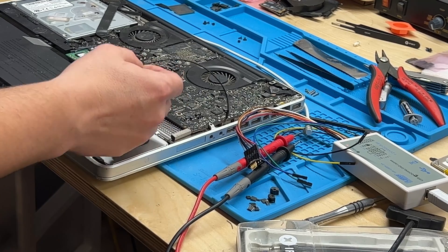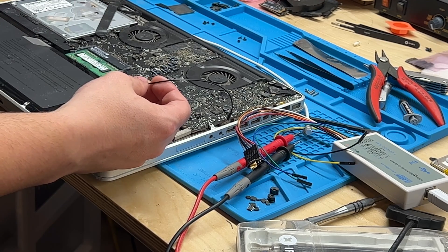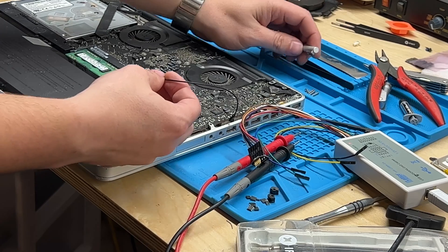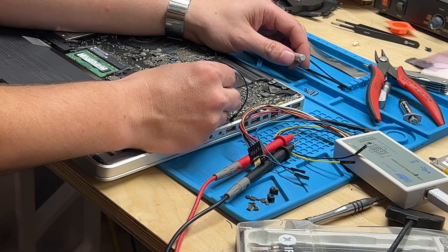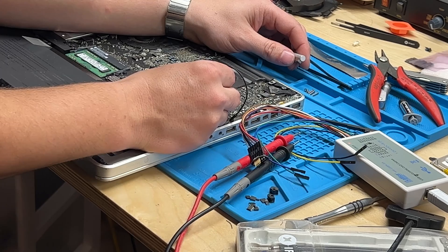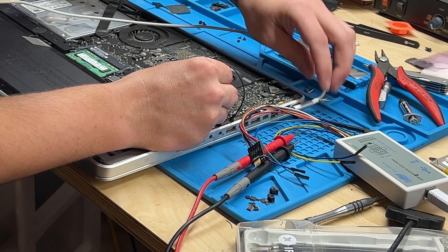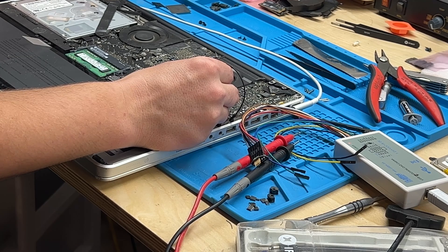First I've got to ground this out and plug it in at the same time. We go into PLT reset L, which will prevent it from booting up but give it power so we can flash it. Once the fans get up to full speed it shouldn't reset itself. We have to touch that first, plug it in — and it does nothing.